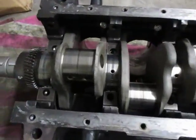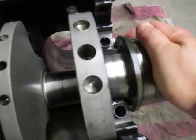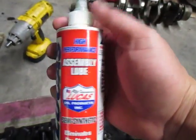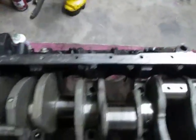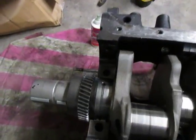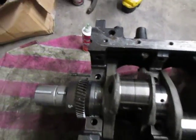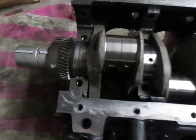Another thing, when you're assembling a short block, the whole world knows to use assembly lube. You don't want to run a motor and have a dry start. We've used our Lucas assembly lube. We actually got that for free from sponsorship. But you can use anything, you could go to any parts store. It's $4 or $5 and you get a whole tube. It all does the same stuff. There's no rocket science going on in there.